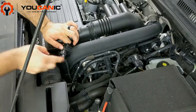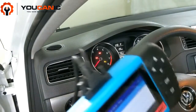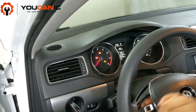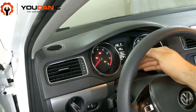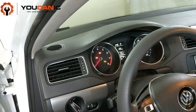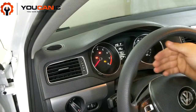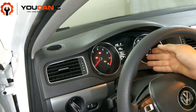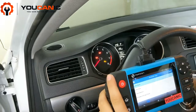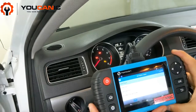The car is no longer shaking, but the check engine light is still on. The check engine light can reset on its own as long as there are no active codes, but it does not reset right away — it could take two or three days. For example, if you had a loose gas cap and tightened it, the light won't reset immediately; drive it a few cycles and within two or three days it should reset on its own, with the code changing from active to passive.